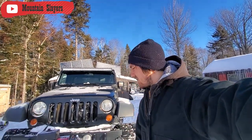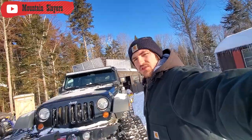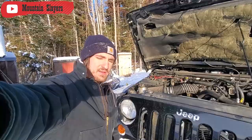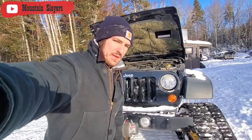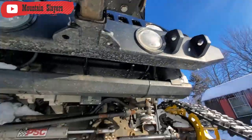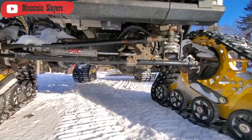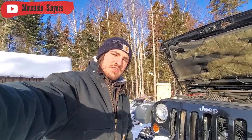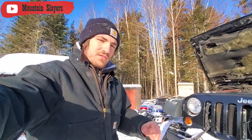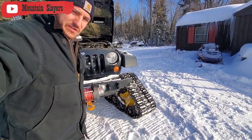So what's been done to it? Well, first thing you need with tracks is some heavy steering. This is a lot of weight to move, especially when you're getting stuck. We opted with a PSC high-flow steering pump, and we quickly figured out we're also going to need a high-flow steering box, as well as a ram assist. Really comes in handy when you start to get sucked off the trail. You've got a hydraulic arm that can force your steering one way or the other in sticky situations.